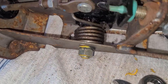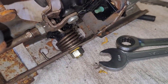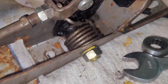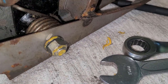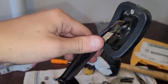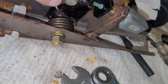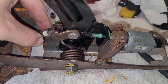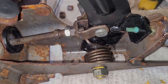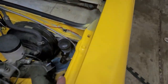This is put back together. I don't know the torque specs — I just got it pretty tight. I strongly recommend taking a picture of the spring before you take it out. Here's how it goes: the little thingies that are bent point away from the nut, and they sit like this on this side of the pedal. So now, with the clevis pin bushing in, this doesn't really move anymore. We'll have to see from my anecdotal evidence after driving around for a while — I'll come back and tell ya. That thing's put back in, seat is in.